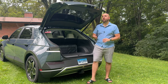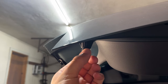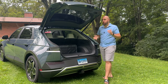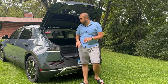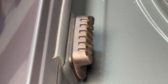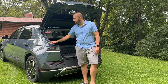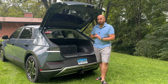On the forums, people talked a lot about adjusting these little rubber stoppers here. They are a screw type, so you can adjust how thick they actually are. People talked about adjusting those and seeing what that did — that made it a little bit better, but it was still there. So before knowing about this TSB, I actually found somebody who had 3D printed some shims and pulled these clamping points off from the side, put these two or three millimeter shims between that stopper and the body of the car, and that pretty much stopped it altogether.